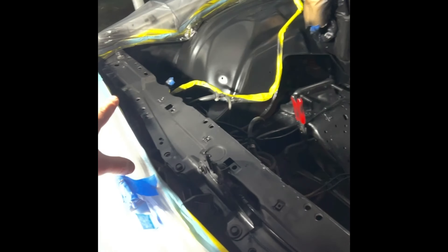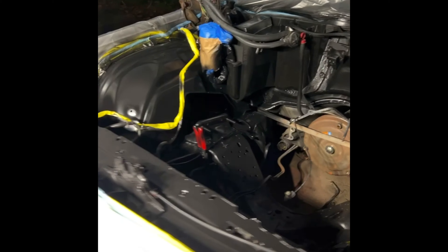Just finished up. It's a little later and colder than I wanted to be spraying, but I got grandpa's old catalytic heater going and it's actually really warm inside this tarp. I felt confident and sprayed the top radiator support, hit the back as much as I could get to, finished up to the wheel liner, touched that up, and also hit the inside and the wheel liner on the other side. I'm gonna let this tarp heat up and bake this paint — man, this came out really nice.